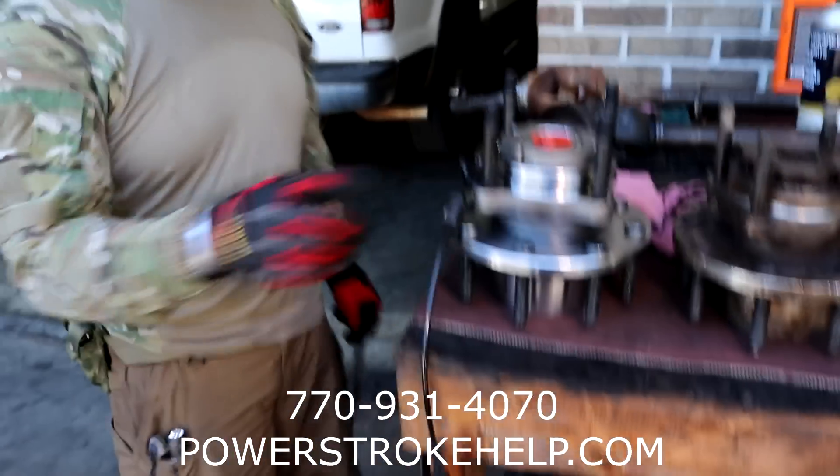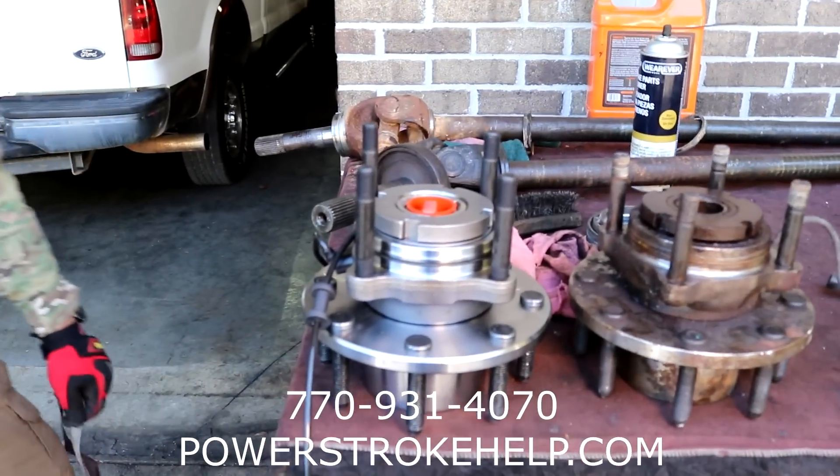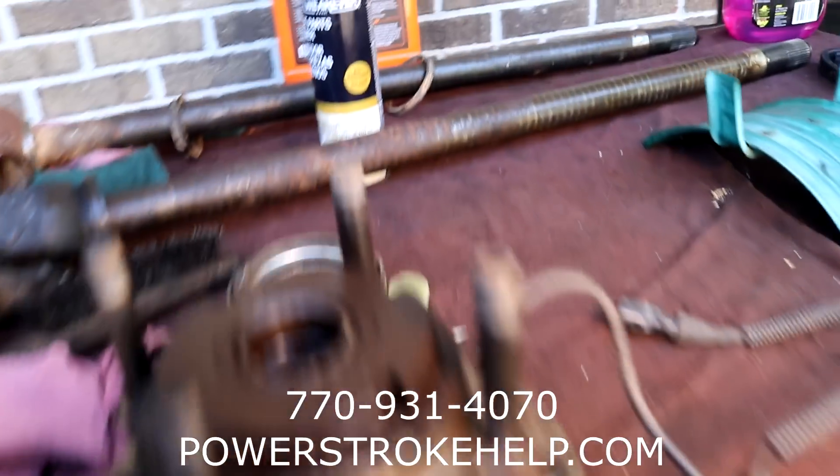Because all the time that you're riding down the road and the hub is turning and the axle is sitting still, the axle is riding on this little bitty roller bearing. It's real important that you put plenty of grease in here - there's no such thing as too much grease. And this problem won't happen to you. The other thing too - what Mike told me was the little breather tube. If it's popped off, which I've noticed mine popped off before, and if you submerge it in water, it goes water right into all that.